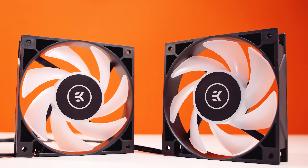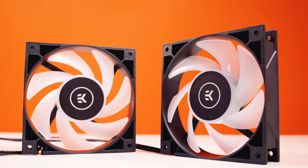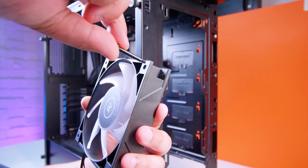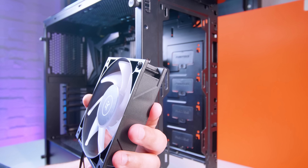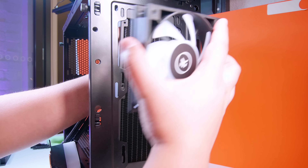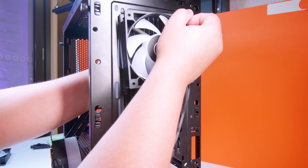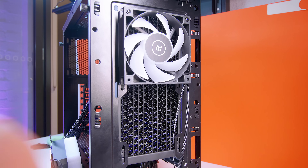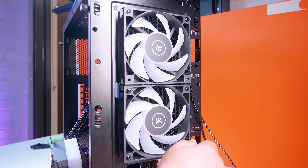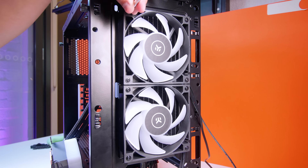Now we're going to install the fans and the radiator of the cooler. You can do this in the other order — water block first — but this is the preferred way. Locate eight of the screws and feed them through the fan. Put the radiator on the front of your case. Remember, this video is for demonstration purposes only — it's only this way on this case, it might be different for yours, so make sure you research before installing. Finger tighten these in first to hold the radiator, doing opposing corners, then grab a screwdriver and tighten them up so they don't come out. It's a very easy cooler to install.